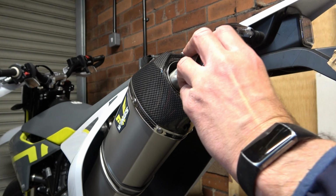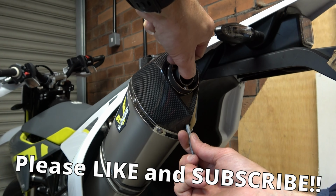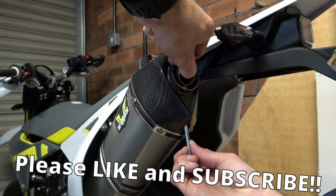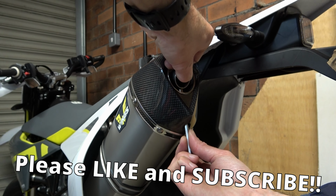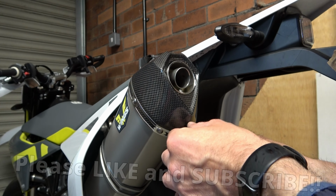With the nut and washer removed, we can now slide in the replacement baffle. At this point I push the Allen key up into the exhaust, using it to locate the hole in the baffle. And once it pushes into the hole, we know they're lined up. I now take the nut and pinching the washer from the other baffle, I screw up into place using the Allen key.